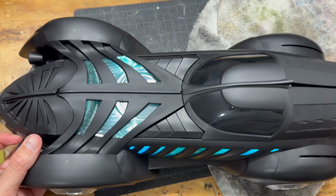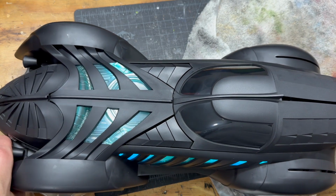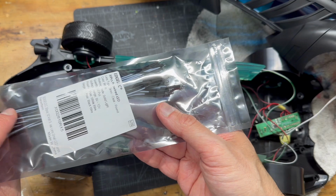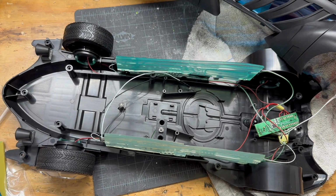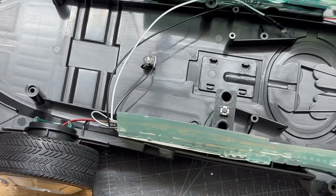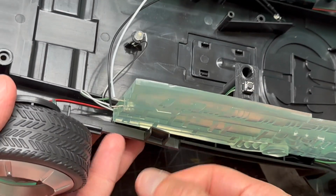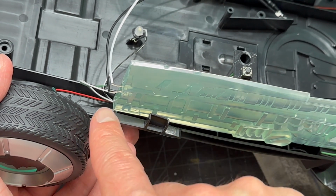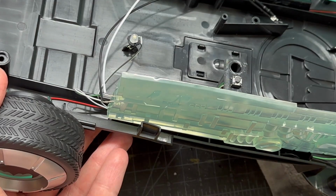So I was like, I really don't want to have to cut these wires open and splice more light bulbs in there. And I have this pack of LEDs from Amazon. I bought a bunch of them for a project. I have extra. So I said, okay, let me try something. And let me zoom in here. Down here on the left, where the bulb goes into the plastic, there's a little bit of the wiring exposed. So I took one of these bulbs and I just clamped the wire tips onto the exposed bit of the wire. And wouldn't you know, it worked.